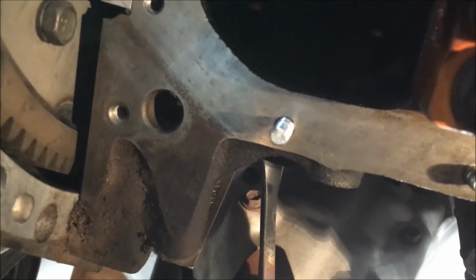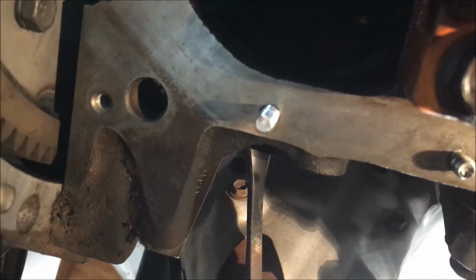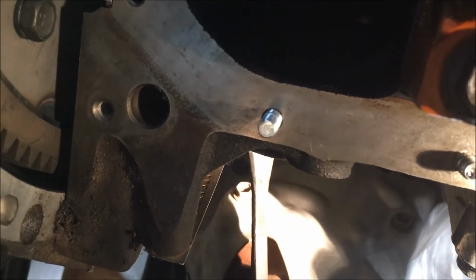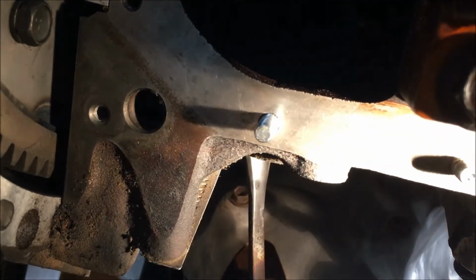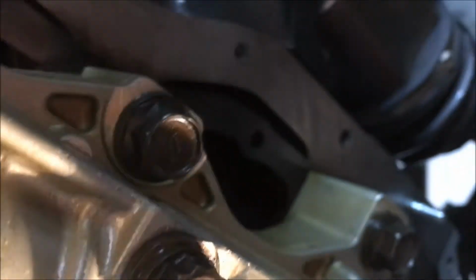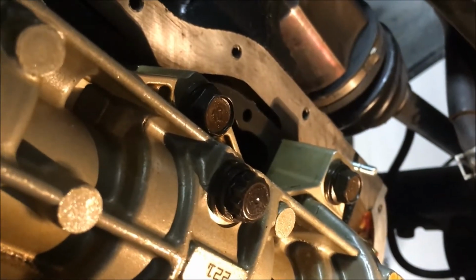As locator studs, so that when we put the pan on, we can just ease it onto those locator studs. Then when the pan is on and I've got some of the bolts in, I'm just gonna take those stud bolts out. It's just so helpful, y'all. So we'd recommend getting some extra stud bolts at Toyota so you can use them as locators. It just goes up so much easier.